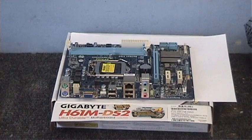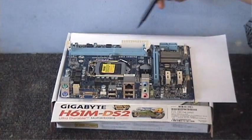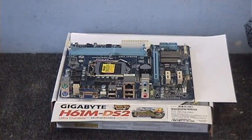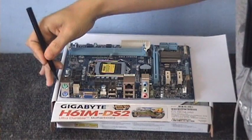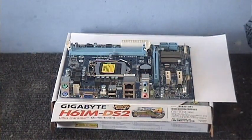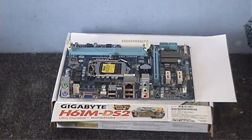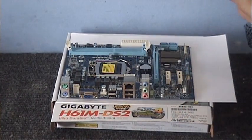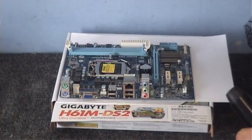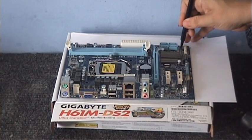So the motherboard will fit in there — this is my method. I've got the motherboard on a piece of paper and I've drawn out how much space of the paper it takes. What I'm going to do is mark where each hole is, then put that in the case and see which standoffs I'm going to need to move. I've got one there — and I've just dropped my microphone. Got another one there. I don't think I've missed any out.